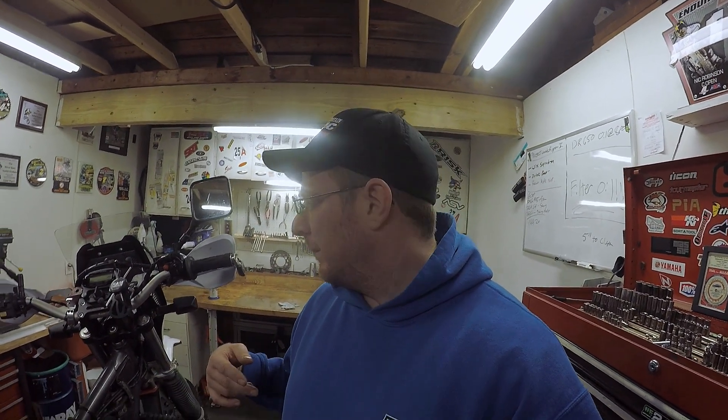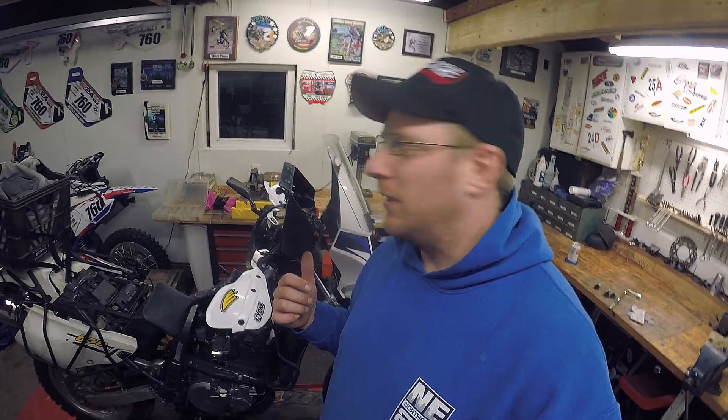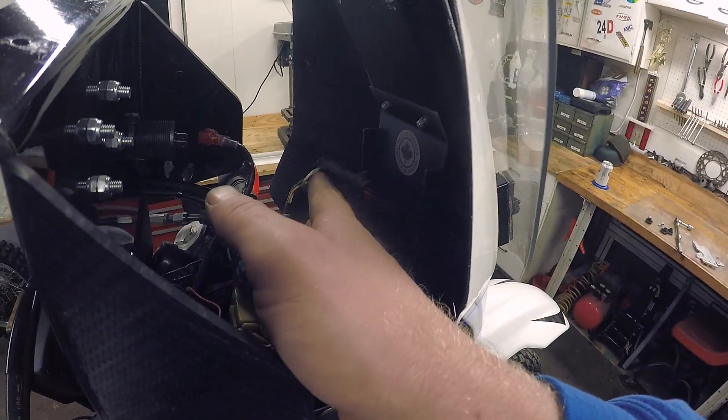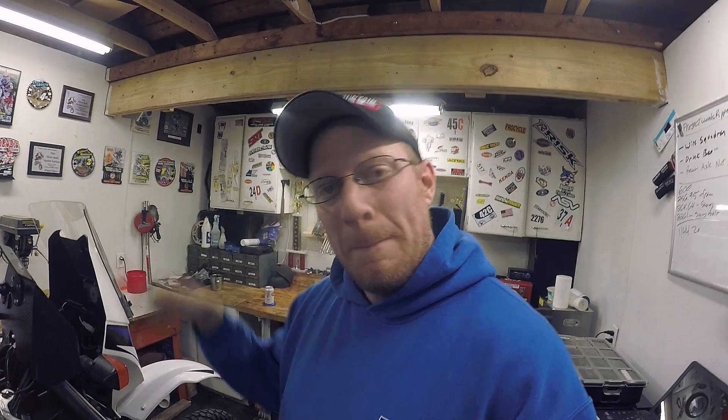I'm just going to take the handlebars off the risers and put them back on during reassembly. As you can see I've got a bit of a mess here — I totally forgot there's a central hole where all the wires run through up to whatever Suzuki wanted to do on top of the headlight. So I'm going to disconnect the headlight, take the two bottom bolts off the fairing, get the fairing up out of the way, deal with the dash piece, then put the bars back on and start planning the tower.